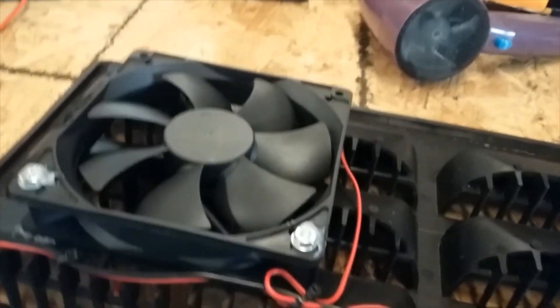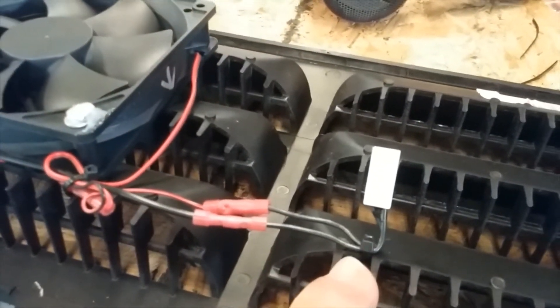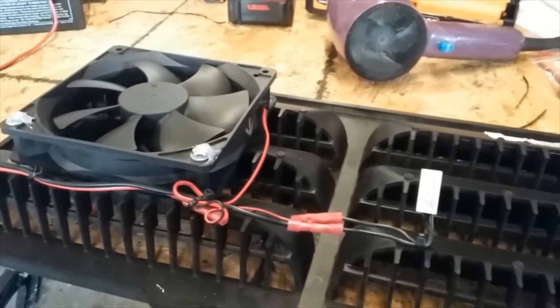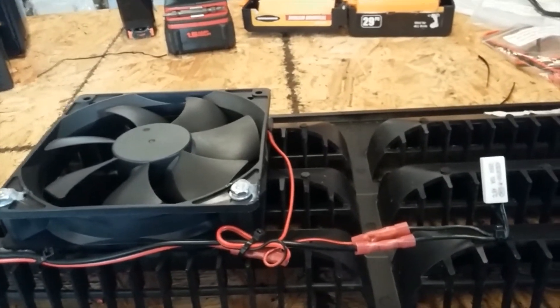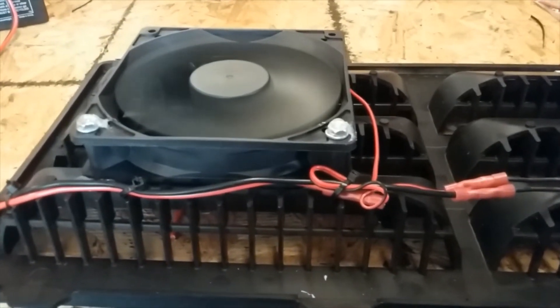Following the kit directions, the wiring is now complete. We used zip ties to secure the wiring to the vent cover. The extra hole we drilled is where the thermostat sits, hanging out in the air to sense temperature and turn the fan on. Now we need to test that everything works correctly, so we have it hooked up to a battery and will simulate heat using a hair dryer.